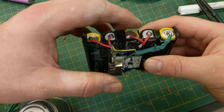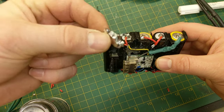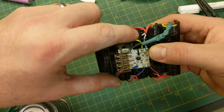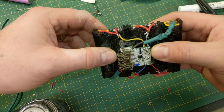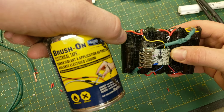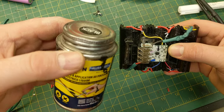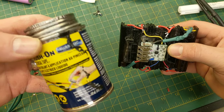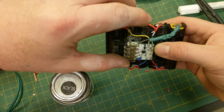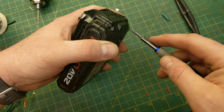The batteries are now wired in. I did have to use wire because I damaged the tabbing on the previous batteries trying to peel them off — not a big deal. I have some exposed solder ends and wasn't able to get heat shrink on them, so I'm going to use liquid electrical tape — also called brush-on electrical tape. I'll put a link below for where to buy it. It's very handy if you need to patch or seal a wire. In this scenario there's not a lot of room to wrap tape around the connections, and I don't think anything will short out, but just to be safe we'll apply some.